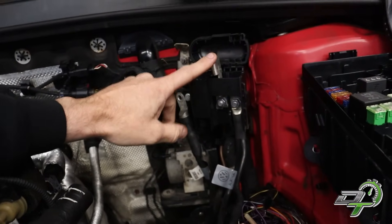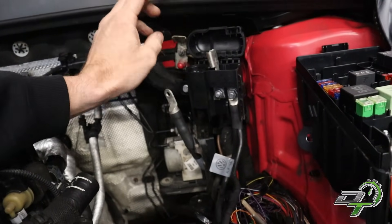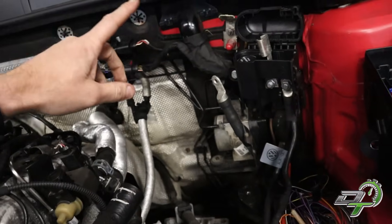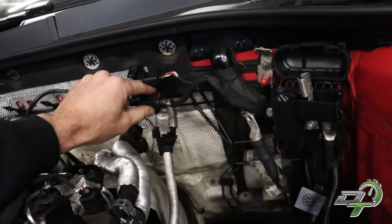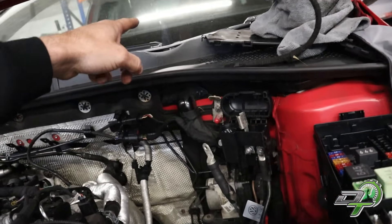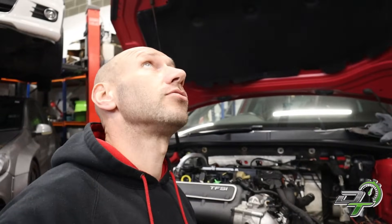The last few little things: the battery bracket and positive terminal point here needs to be tied into the fuse box and also tied to the back — I've got it unhooked because I haven't mounted the battery yet. I also had to change the plug for the lambda probe and run an extra wire for the wideband probe. The battery maintenance module normally comes off here and goes to the negative terminal, but I'm now going to have that at the back of the car — so I've spliced them cables onto a two-core cable I've already run through to the boot. It is absolutely lashing down outside.